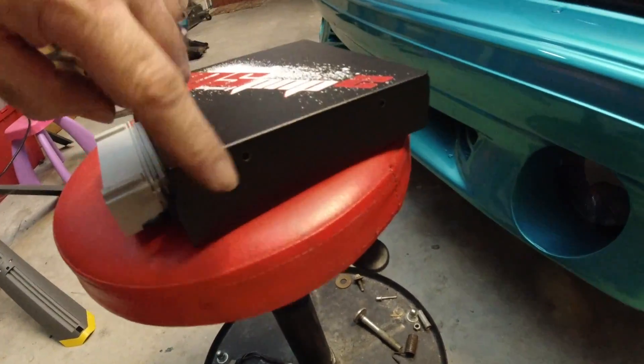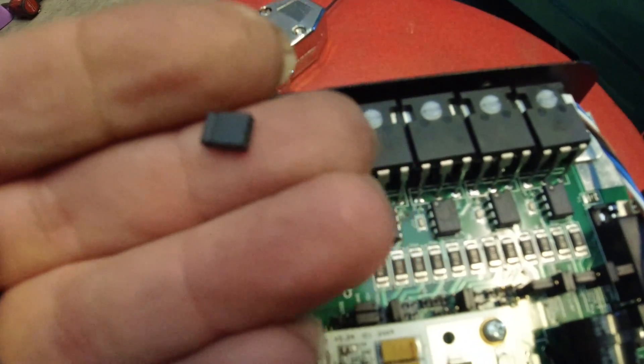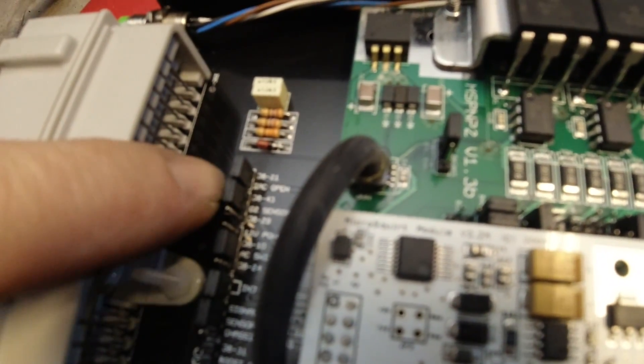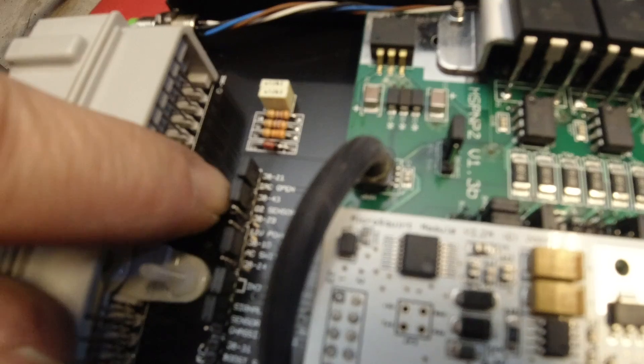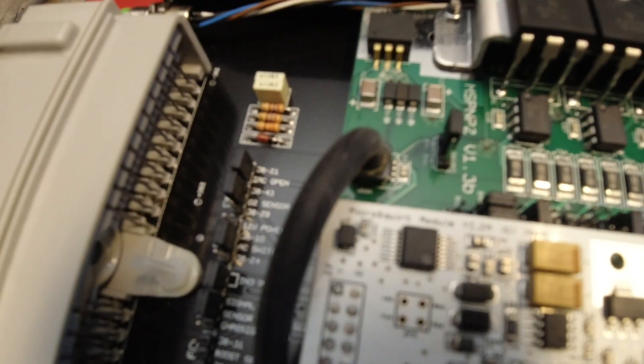On the inside there's something we need to change. There are four screws — take those out — and you're going to have two nuts right here that you have to remove. Pull that off. Inside you're going to have a J8-43 and O2 sensor. Originally it is set up on the O2 sensor and J8-29. What we want to do is change that to J8-43 and O2 sensor, so you're going to jump this over to that side. All that's doing is telling the computer that we're going to be reading off of the driver's side instead of the passenger side. That's the way LMR did it, that's the way I'm going to do it.